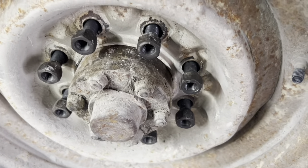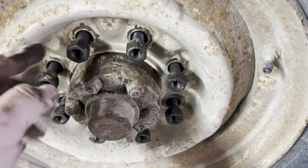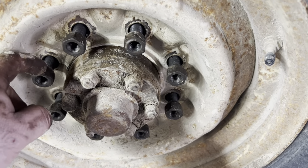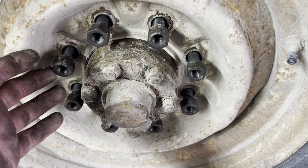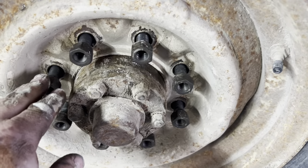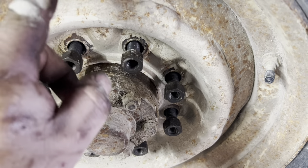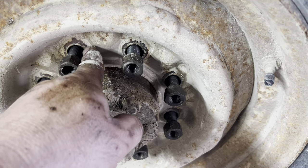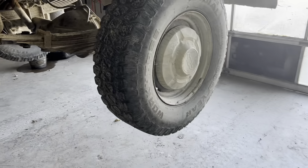When I was probably about 10 years old, I watched my dad put this wheel on and just zip one lug nut down and let her hammer before zipping any others down. When he zipped the other one down the wheel shifted a little bit. In his defense, the impact we were using wouldn't twist off a wet noodle. But still, that's why you run them down evenly and don't over-torque your lug nuts. Over-torque on aluminum rims and it deforms the rim; over-torque on steelies and it deforms the lug nut so it does not want to come off the threads — you've got the taper pinched down against the thread like a lock nut.